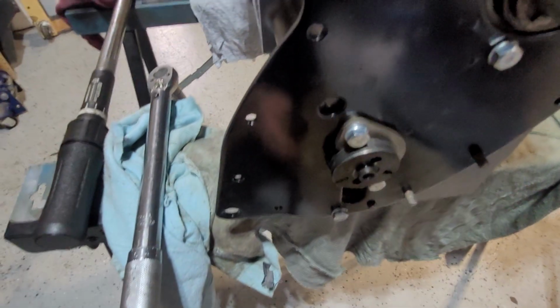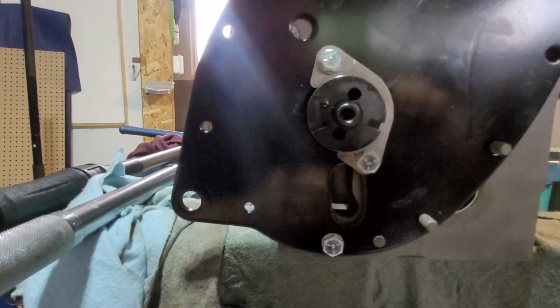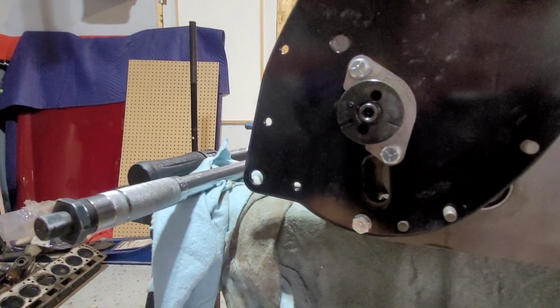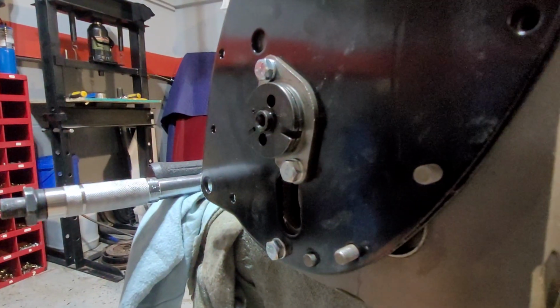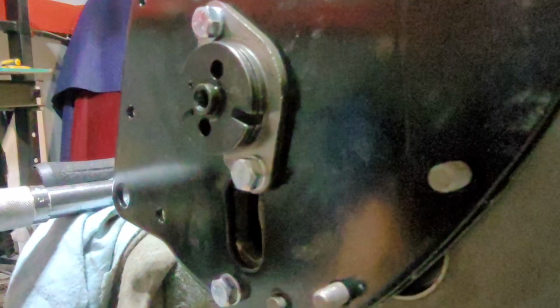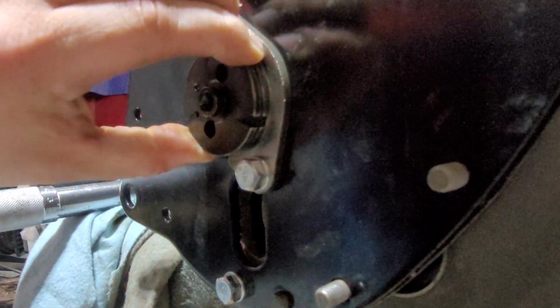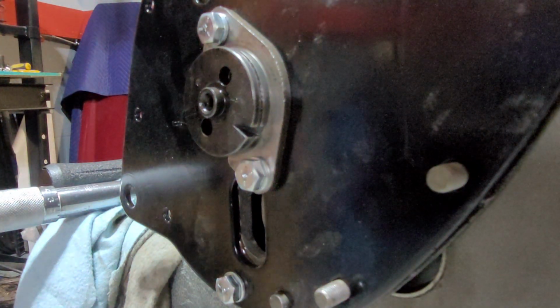So, let me lower down here, see. So when we're looking, sorry because of the glare, when we're looking at the camshaft, it will tell you to measure the distance between the inside lip here and the key. So this little space here. So some will put a feeler gauge in here. To me, to be honest, that looks like it's moving, but looks like pretty much zero play on it. We'll find out now, but I'm pretty sure there's no play left on that.